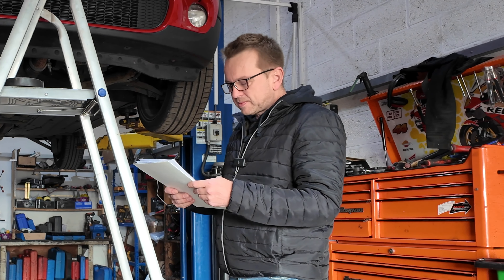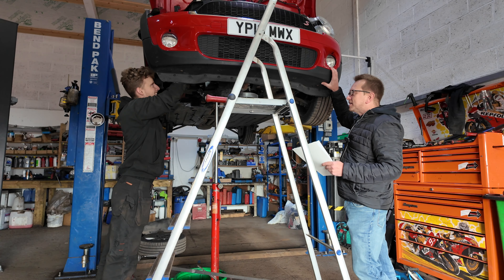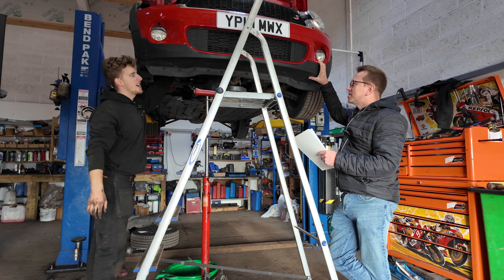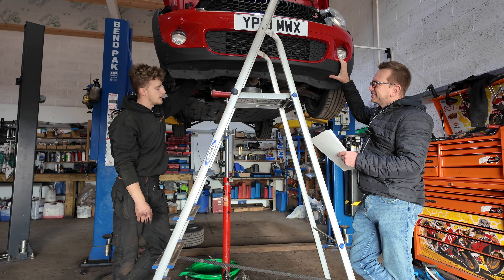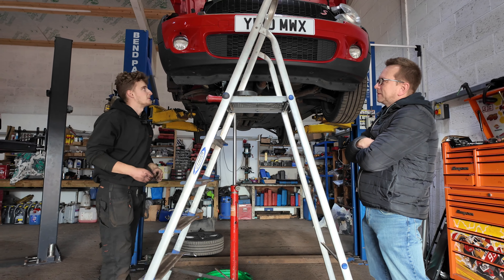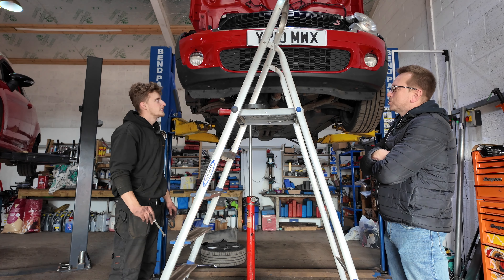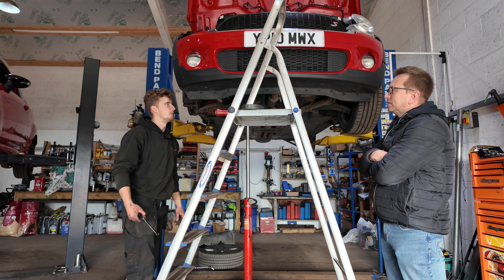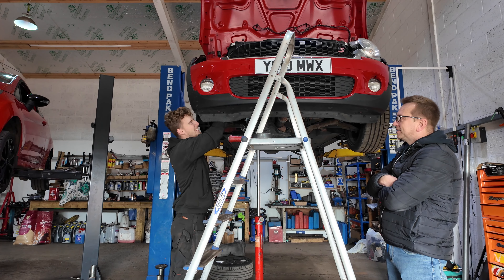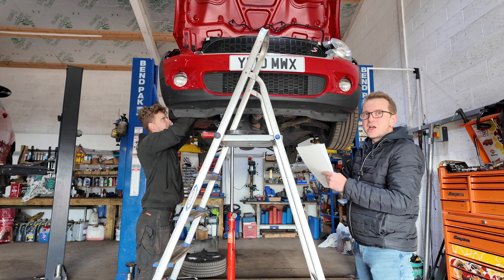From October to March it went all right, until I had an epic fail on the engine management and the car just went awful — it sounded like it was farting. That was the coil pack that had gone, number three. Is that a common issue on Minis? Yeah, it's common — the coil packs sit right on top of the engine, so anything that gets into the engine bay affects them. Plus there's a constant pulse of about 25,000 volts going through them every time they fire. I thought the engine had gone completely, but we also changed the spark plugs. The cost of that came to around £375.